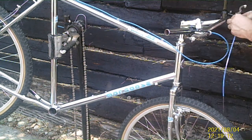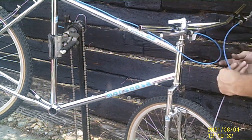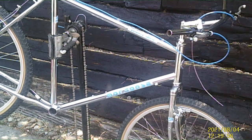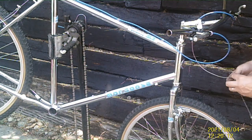The cable is really easy on these to set. This one has an actual pulley on the hanger. Since you take the tension off the brake levers themselves, the cantilever brakes, it's easy to set the cable.